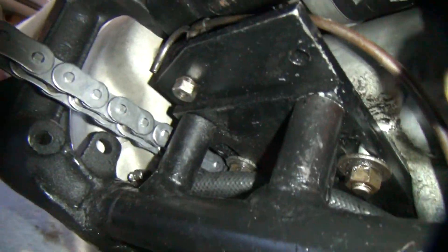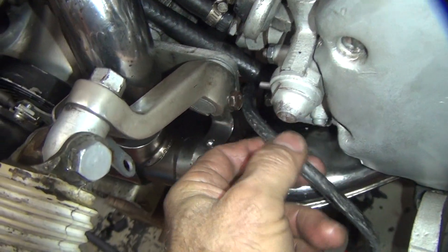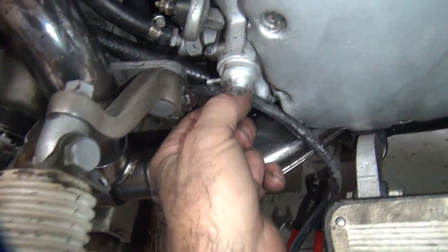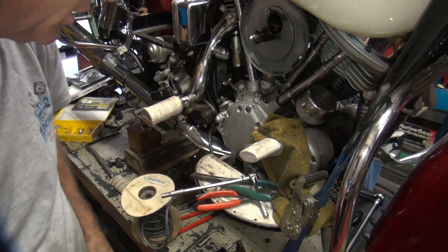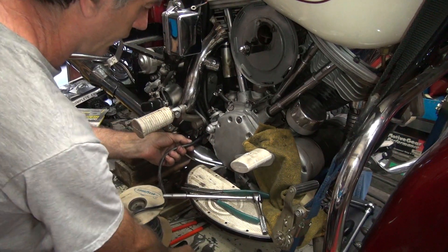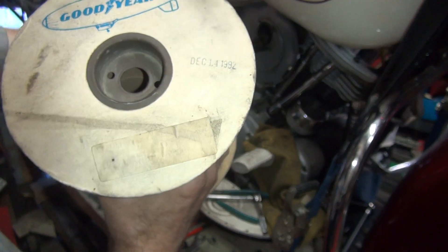This here is cut slightly long — that's why I was fighting it. It looks good underneath. There's a tube that comes across the frame. That's why I went to the low route — look at all this room under here. I think this goes straight into the foot peg bracket, so you don't want to pull it taut and cut right there. You want to pull it back a couple inches so you've got room to work. It's always best to have a little excess on your lines. Cut that off right there.